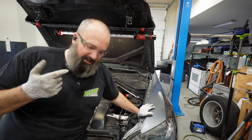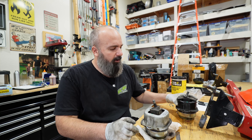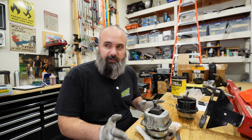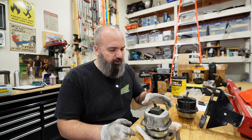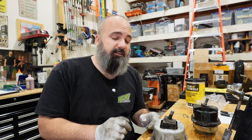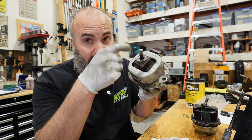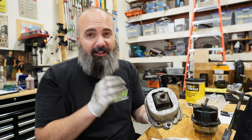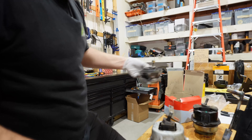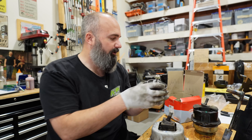Not a lot of bolts we had to take apart to get those out of there. So what was the cause of my failure here? I think there are two primary causes. The first is age — this car is 14 years old with around 178,000 miles on it. That's a pretty big contributing factor. The date on this is 2009, so these are original mounts. The second is oil. There were lots of oil leaks on this motor, and there was oil just about everywhere. That oil running down onto this rubber surface is not going to be great for it. Another example is the motor mounts I did on my 540 — you can see these guys cracked all the way around because they were pooling up with leaking oil.